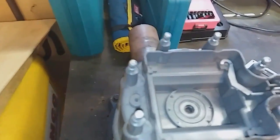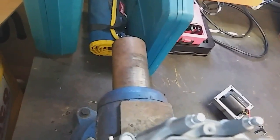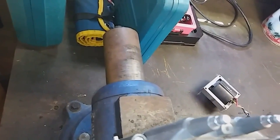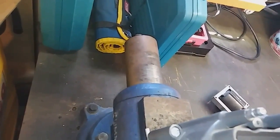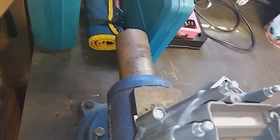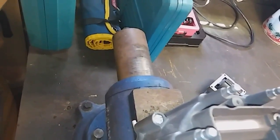You just slide the coil up. You don't have to pull this out, but I'm hoping there's something wrong with this cap and this rotor. When me and my brother inspected it real quick just a second ago, it honestly doesn't seem like there's anything wrong with it besides it running a little off to one side — because it could be advanced. But a hairline fracture is a hairline fracture; I have to do process of elimination.